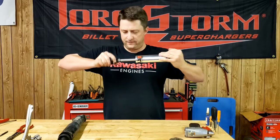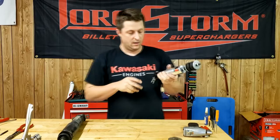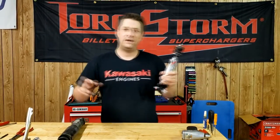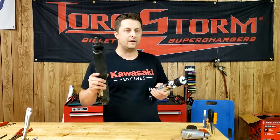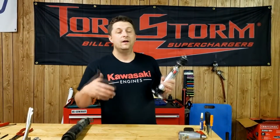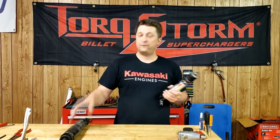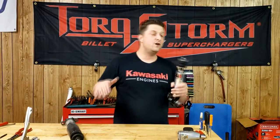On the compression it's pretty good. Right there in the middle, that would give you great everyday all-day cruising stability — it wouldn't have a ton of body roll, and the truck would handle pretty close to stock, probably better. The point being, the single adjustable shocks do work, and they are very, very adjustable. You can go from drag racing to everyday cruising to super tight with no body roll whatsoever.